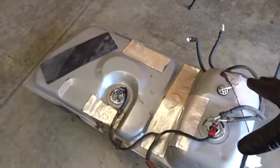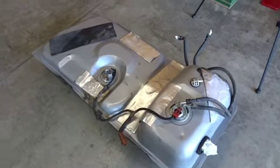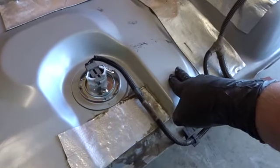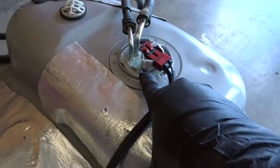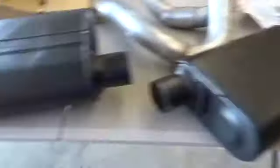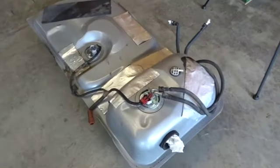Also, I pulled the tank and I think the tank has been replaced before. I cleaned it up so it looks like new, and inside of this thing is like brand new. So I'm hoping it was the fuel level sending unit — it might not be. Because if this tank's new, the fuel pump and the fuel level sending unit was probably replaced too, because they look fairly new as well. I'm just hoping that the fuel level sending unit went out again, or they just replaced it to replace it because they had the tank down. So here's the Flowmasters — they look pretty nice. The muffler itself has got this black coating on it, and on the side of the tailpipe it says Flowmaster. These are some nice pipes, so we're going to go ahead and put these pipes and mufflers on and get this fuel tank in. All right, let's get to it.